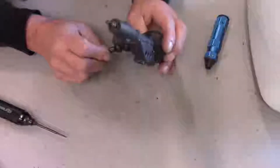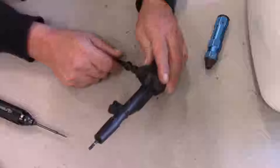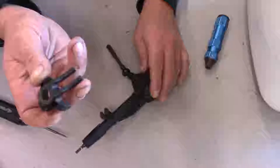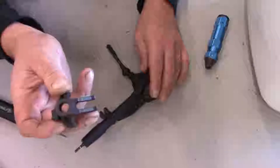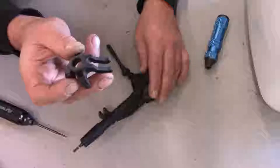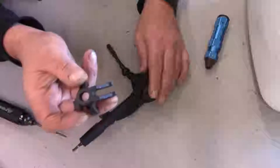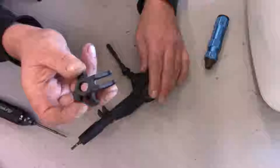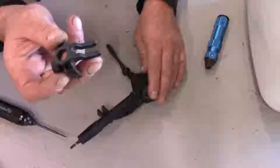Now, the rear differential, everything seems to spin real freely, unlike the front. The front, I had one set of bearings on this spindle here that were pretty well seized up, so that's another good reason why I do your maintenance, especially if you're gonna do something like play in the water. If you're in the snow area, blow them off, spray them down with any kind of lube, anything to protect it, whether it be WD-40 or anything like that. All right.